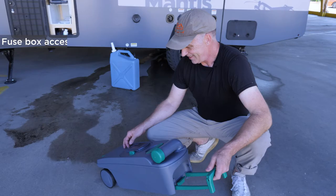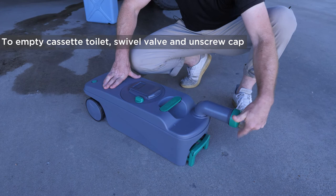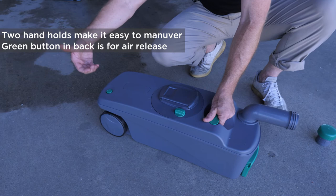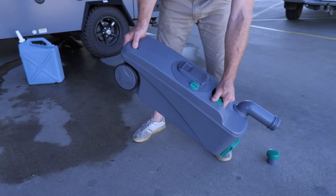When you get your tank to where you're going to dump it out — be that at a dump station, in a toilet, or a pit toilet at a park — you swivel this out and take off the nozzle. There's a handle here and finger holes under here with your thumb up here. This is an air release button so it doesn't go glug glug glug — it pours smoothly. You press this, lift up, and dump. It's pretty simple.